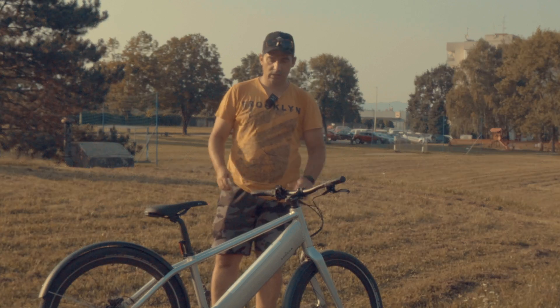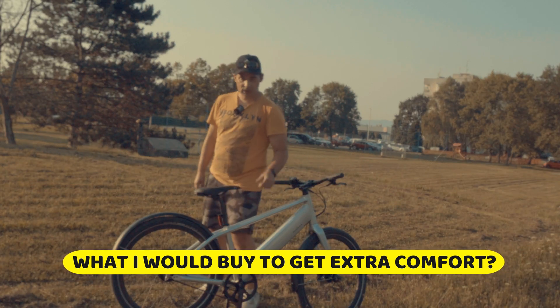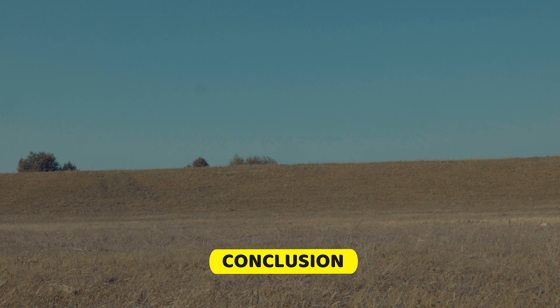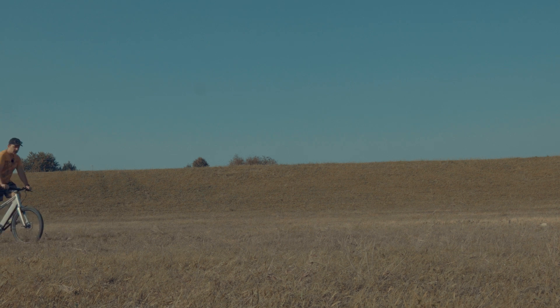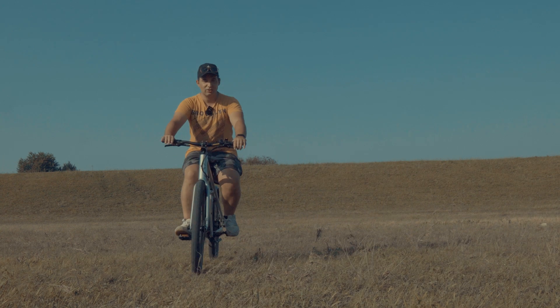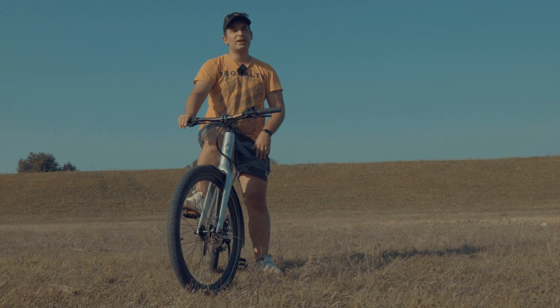If I were to buy this bike, I would definitely get one accessory: a hydraulic seat dropper. You remember riding as a kid standing on the bike — this is very possible here because it has a torque sensor and you can drive it standing. I put it in second gear and just drive like this and have fun. With a regular cadence sensor, I can't do it because the motor is faster than me, but this one just listens to my legs.